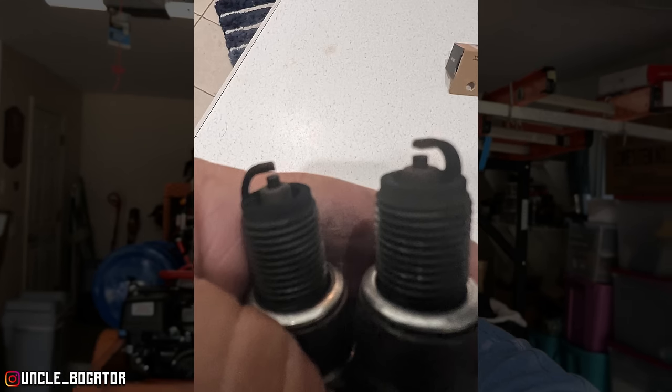It is the following day. I stayed up a little bit last night after turning the camera off and put the new air filter in — big shout out to my boy Echo Five Training who provided that. Then I changed the spark plugs. I suspected they were going to be oil fouled, but they did not appear to be. They did show signs of excessive rich running, and I think the air filter had a lot to do with that.